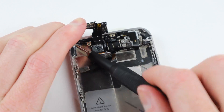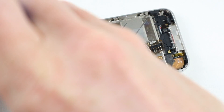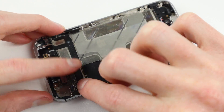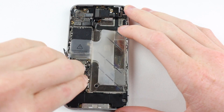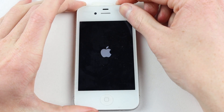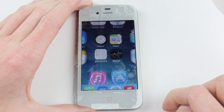I reinstalled the screws for the screen, completing the screen installation. Then it was time to put in the repaired iPhone 4s logic board, making sure to remove the screw for the grounding clip up top before screwing everything down. I put the sim tray in to keep the board in place while connecting all the connectors, then moved to the bottom to install the speaker assembly, adding new screws since this was a bare logic board with no hardware. With a battery thrown in and the phone turned on, it's running off its own power and all buttons — power, home, and volume — test successfully.